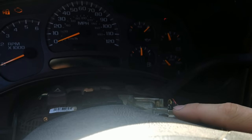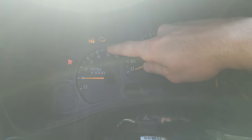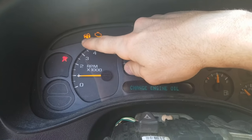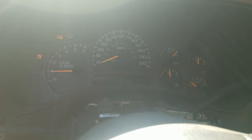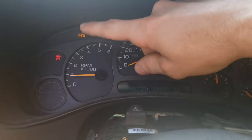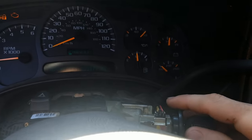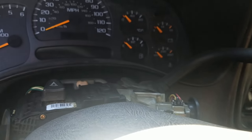I also want to say that after you do this bypass, your security light will stay on. For example, the check engine light is on because of O2 sensors, so don't worry about that, but the security light will stay on — the truck runs and drives just fine though. You could take that light out, or supposedly if you put the right resistor in there you can make that light go out as well, but the way I'll show you it doesn't go out.